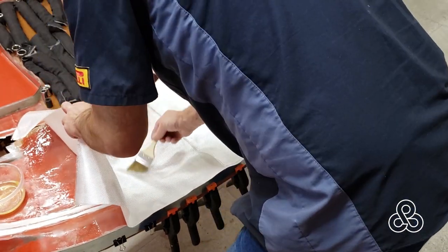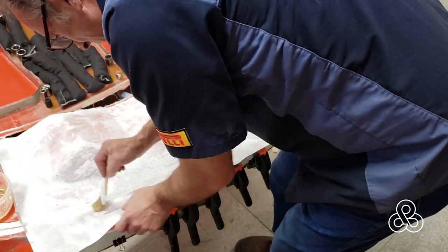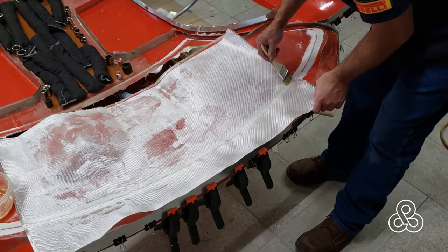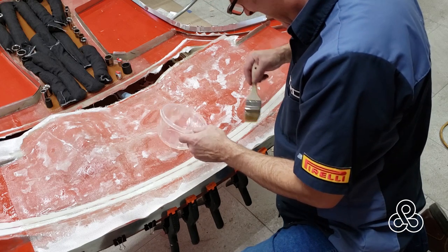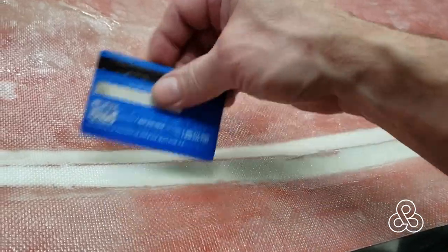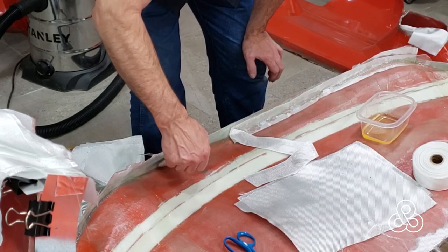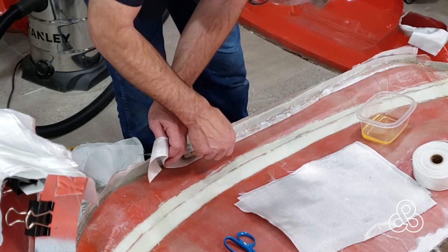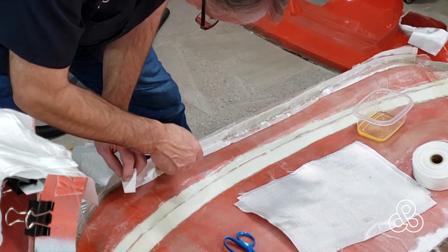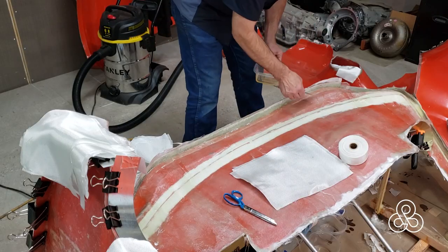The fibers came up around the corner and onto the dash. We're going to lay some fiberglass cloth on the dash. If you remember in the last video, I used some Q-cells to thicken up some resin and fill some of the grooves so we wouldn't have to keep working the fiberglass into those deep grooves. Here we are now working that fiberglass right across that Q-cell fill — makes it a lot easier to lay the resin down. Another thing is fiberglass tape — these are just rolls of cloth with a selvedge edge on both sides so they don't become frayed. Here a little half-inch tape going around all the flange on the dashboard to strengthen it up. The front bulkhead or footwell will actually be right behind that flange we're working on.